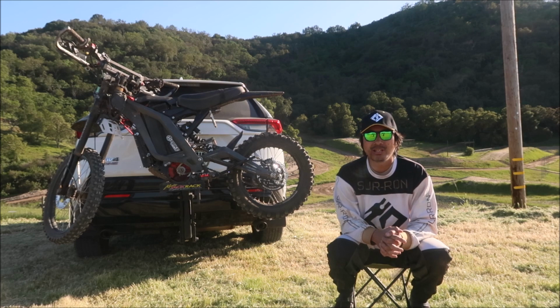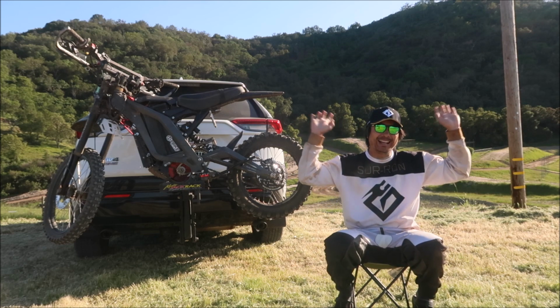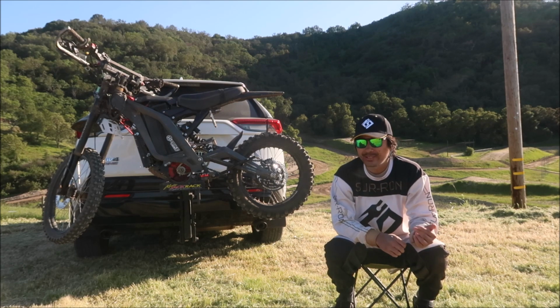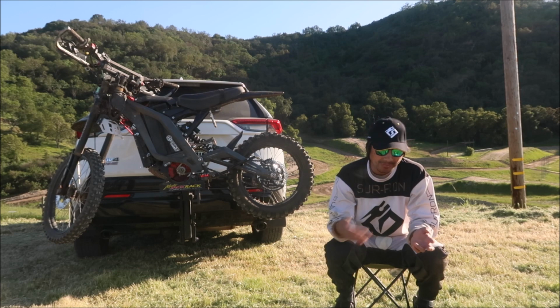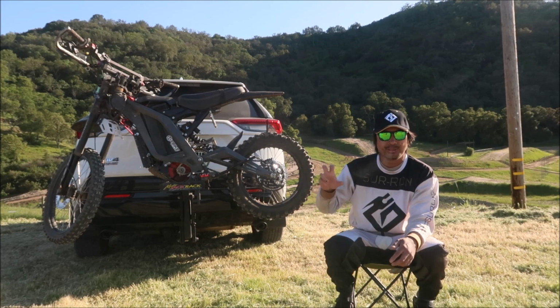Yeah, and then I just had to kind of hobble it to the finish line, guys, and I got a standing ovation when I came back. It was pretty joyous, but I had no rear brake. Riding with no rear brake, it sucks, man. You can't get the bike to slow down around the corners, and if you use the front brake, it washes out. So there's something wrong with this front brake. I think I need to bleed the brake. So I will go bleed it, so it'll be stiffer.